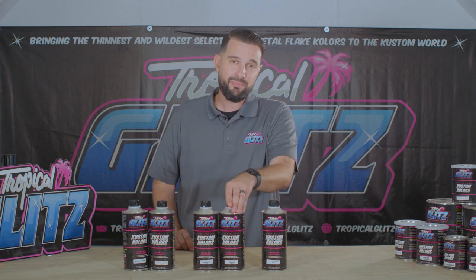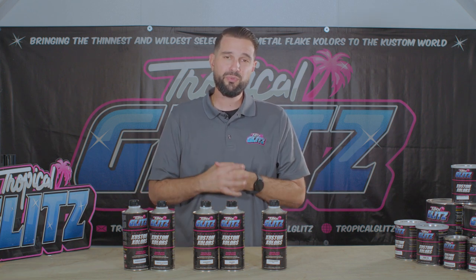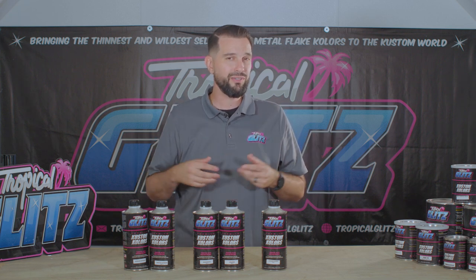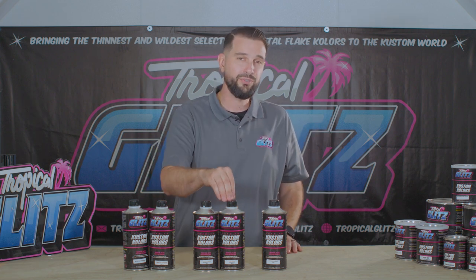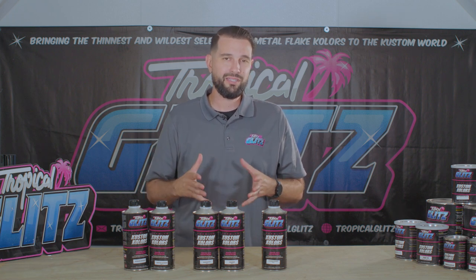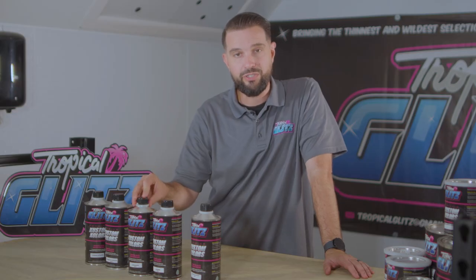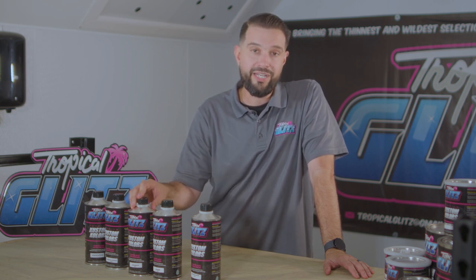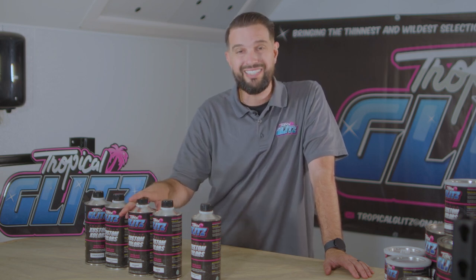Retarder is the opposite — it's designed to slow down your product. A great example: when I'm spraying primer here in Miami, Florida, on an average day we're at 98 degrees with high humidity. So if I'm mixing primer and need to get it out spraying well, nice and smooth, I'm going to introduce retarder because it's so warm that I need the primer to lay out thick and smooth without any dry patterns. If you put too much retarder in your primer, base coat, or clear, it's going to die back — meaning the paint looks fantastic right after spraying, but you come back an hour or the next day and it looks completely dull.